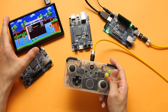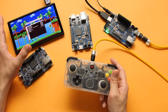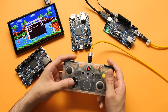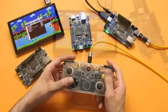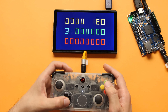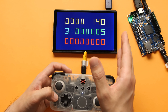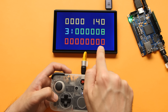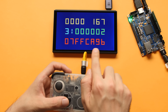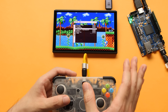Here we are. This is the system I've been using for the last couple of days — I've been having a blast with this platform. If you've never used the MiSTer FPGA project before, it is amazing. Nothing comes close to the experience you can get out of this, and now that it's finally affordable, a lot more people are going to be able to try this out. Let's start by going into the utility section, then over to mem test. I'm going to set this to 140 megahertz. This green counter shows you it's passing the RAM test. If it couldn't reach the speed we need, the bottom counter would start increasing — and I can show you that by increasing to a higher frequency, and as you can see, it starts to error out.